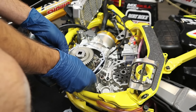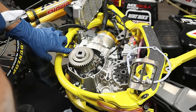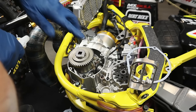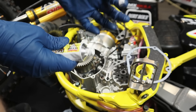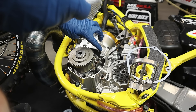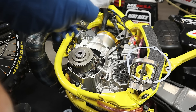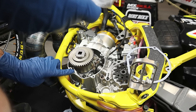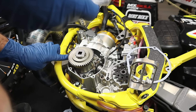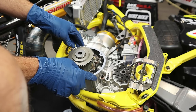Panthera wants you to put a little bit of silicone on the black rubber grommet. I'm going to bust out the 1211 again and use it all the way around — just like sealing up a set of engine case halves. Going ahead and dabbing it along this edge. I like how easy it is to use because it cleans up nicely — if you don't get it all over the place it wipes off really easily. Anything that squishes out when we do the final tightening will just wipe right off. You can also wipe 1211 all over your gasket and drop it on — it'll help tack it into place.